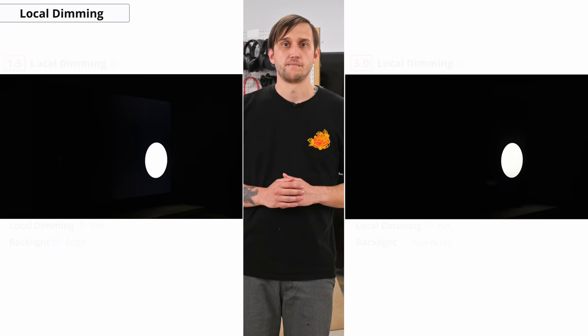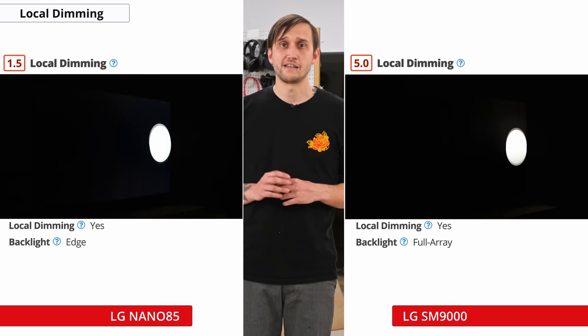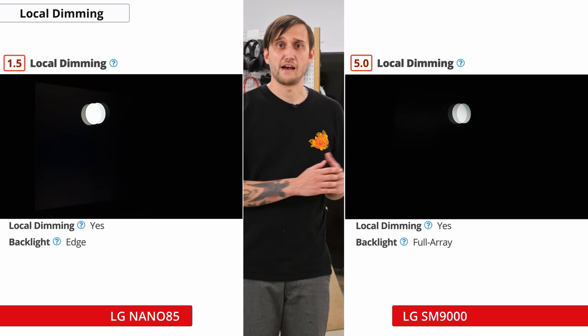While there is a local dimming feature, this TV is still only edge-lit, so the local dimming isn't nearly as accurate and effective as TVs with full-array backlighting, where the LEDs are behind the entire LCD panel as opposed to only on the edges. The local dimming on this TV is very bad and makes darker scenes appear noticeably worse. You can clearly see the zones lighting up across the vertical axis of the screen, and though it's slightly better when set to medium, it's still very noticeable. While watching an episode of Stranger Things, it would light up parts of the letterbox bars and flicker a ton if any light was moving between the different local dimming zones, which was very distracting. Overall, while last year's SM9000's local dimming was still disappointing, it wasn't nearly as bad as this.